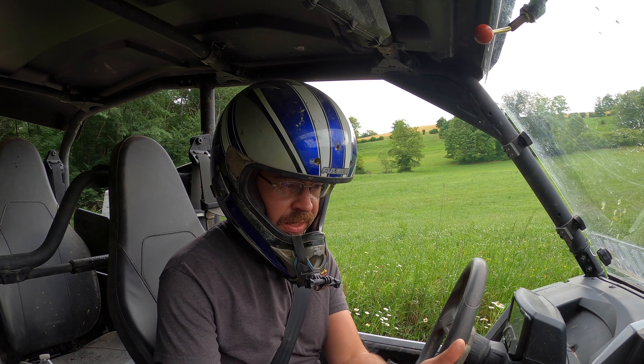The test is the exact same — same pressure in the tires, about the same amount of fuel, everything in sport mode, four-wheel drive, regular four-wheel drive in high gear. First run, stock, in the driveway, 0 to 30 — in 3, 2, 1, go! A little dusty. We had a first 0 to 30, all stock, of 3.72 seconds. I didn't spin at all — I had to get the belt warmed up. And I'm in four-wheel drive so I'm not going to spin.